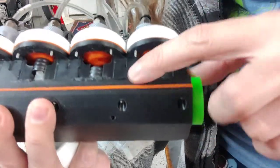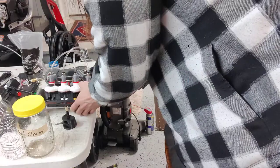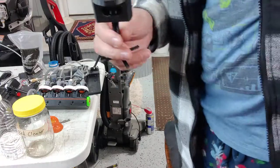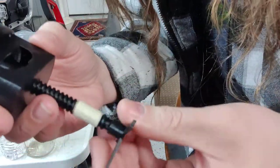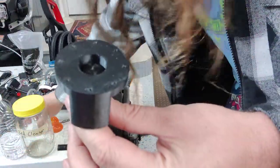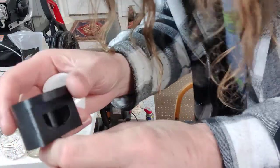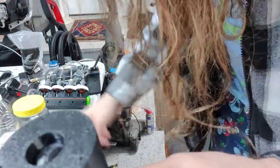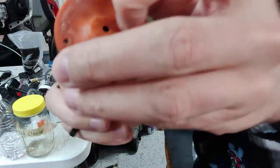This is the cutout design, so you can see what's going on in there. You can see the diaphragms, and I wanted to talk about that really quick. One of the latest breakthroughs I've had is that you can use a diaphragm pusher — this is what I call it. This is one of the three tools that come with this engine once I release the files. You put your diaphragm on there before you put a hole in it, and you can stretch it.